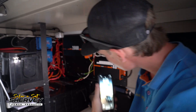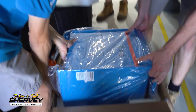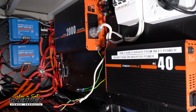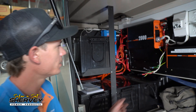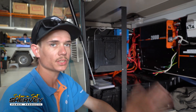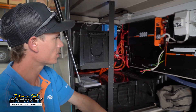Doing a pre-inspection, it's just a bit of a mess. I'm going to take that out, take that inverter out, and we'll put a big 5 KVA Victron MultiPlus in there to run the bus. The battery's staying, that main charger will stay — I might have to move it — and then find somewhere to put our new MultiPlus because it's going to be quite a big unit. First things first is just get that out, figure out what we need. I've got to put a multi-control inside the van to turn the inverter on and off with, and then build a board here and probably mount the new inverter to that.